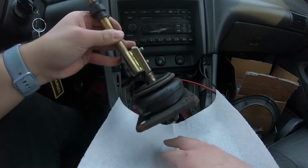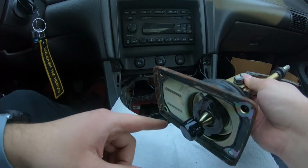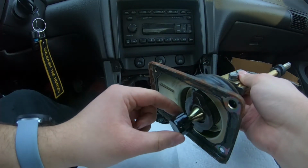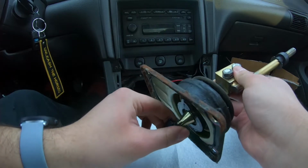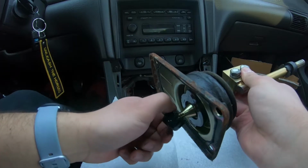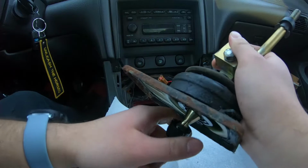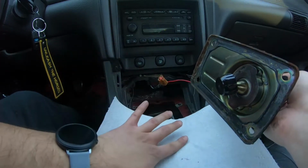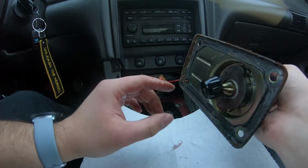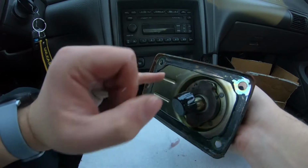Okay, looking good. There's nothing really. So this pivot cap here, on the pivot cap, whatever you want to call it, there we go. See, we got some tranny fluid. You're gonna have to take this off, so it just pops right off, or it should pop right off. Nothing has been going smoothly so far. And then you want to transfer this over to your MGW short shifter.